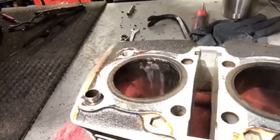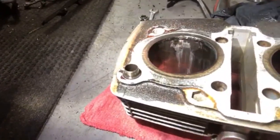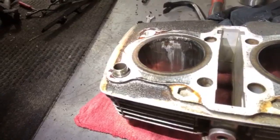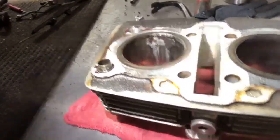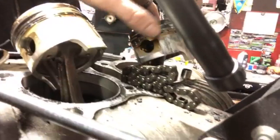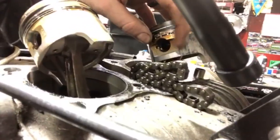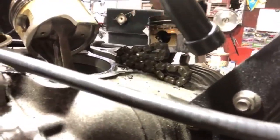I think it's moisture, man. I don't think it was a lack of oil. I think it sat for a long time, right? And he, not the guy who owns it now, but the guy before, ran it. And when it sat, the rings were stuck, and then it just started to tear straight into the cylinder. That's what I think. Even the sides of the piston, on parts that it doesn't normally wear on, are worn. The rings are completely seized.